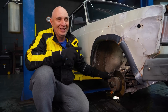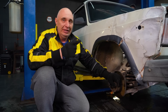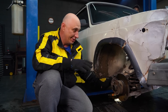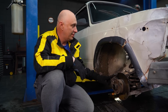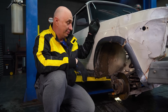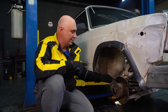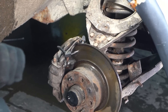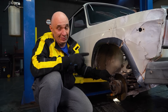All right, so check this out, guys. This is rather interesting. The rotors are only going to get doused with water if they were to get really hot. One could argue that you shouldn't allow your brakes to get that hot in the first place, but that's not always how it goes. Anyway, we came up with a fairly simple design. We took a few regular old windshield washer jets of the type that spray fog and not a stream. When the brake pedal is pressed, that activates the pump. This sprays water and the water cools down the brake rotor, preventing it from overheating.